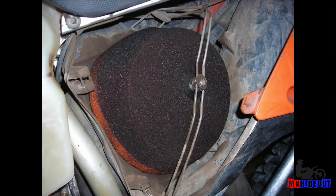The third thing to check on every four-stroke bike you're buying is the air filter. A lot of people who don't like working on dirt bikes neglect or forget to change or clean it, and it's really the only thing stopping dirt, mud, and dust from getting into your engine. If the air filter is dirty, more dirt gets into the engine, and dirt wears out the piston, rings, and valves a lot quicker. If it's really dirty, you might need to rebuild the engine sooner than later.